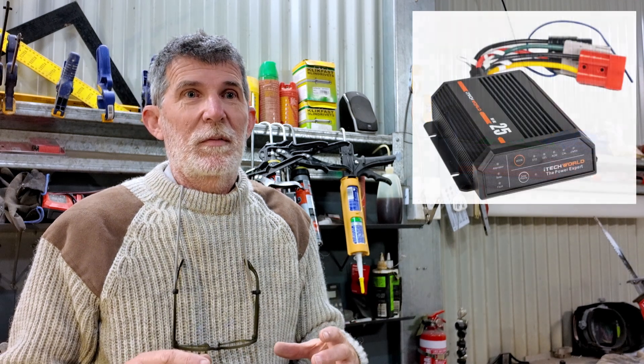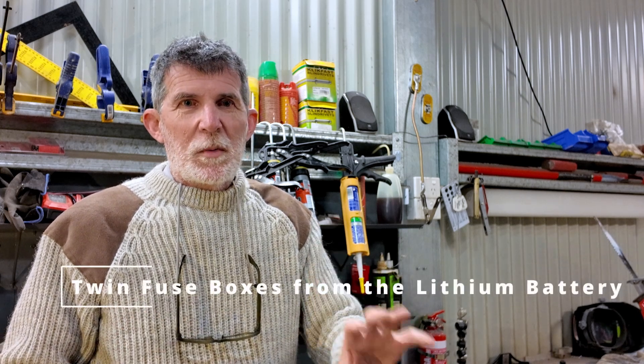The next major addition is a lithium battery — a 100 amp-hour thin-format unit behind the passenger seat, charged by a 25-amp DC-DC charger from the alternator. From the lithium battery I'll run the console fridge, UHF radio, tire pressure inflation system, and the electric rear view mirror. I'll have two fuse blocks: one permanently switched on for the console fridge so it runs 24 hours a day, and one ignition-switched so the UHF, tire pressure monitoring, and everything else comes on with the ignition.